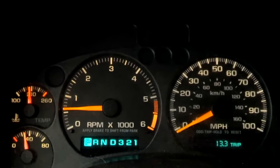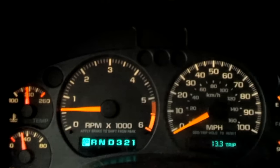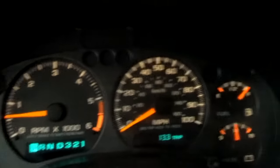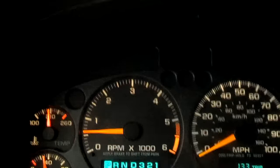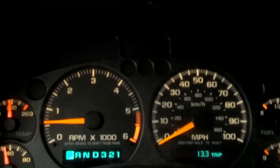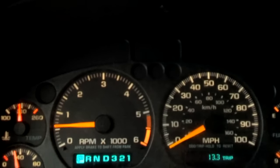Good morning, North Carolina Prepper. Got a problem with the ABS and the brake light on my truck coming on. It's an intermittent problem. As you can see right now, it's not doing it at all. I believe because it's a rainy day outside, it's a grounding issue in the front. There is a connector ground in front of, or on the side of, the radiator up front.